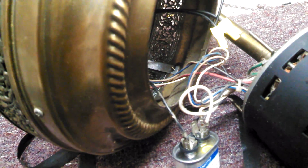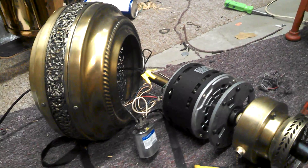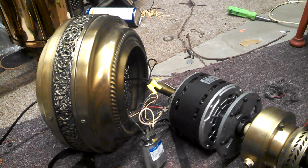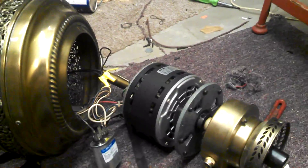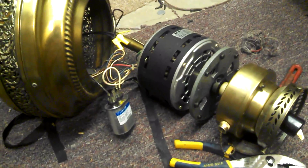So I said to myself, well, there's only a few things that could still be the case, because if it's not the capacitor, it's either one of the connections to the capacitor or it's one of the motor coils. And the motor coils are very unlikely unless there's physical damage to the motor or it got burned up, and neither of those seem to be the case.